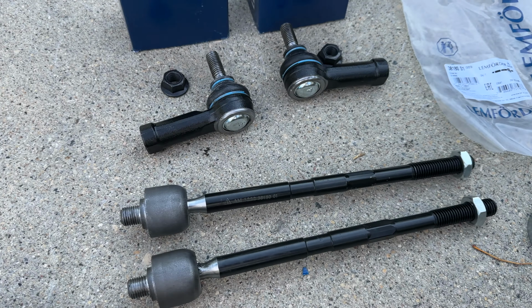31 foot pound and 15 foot pound for flare nut fittings. So I am using here 30 foot pound of torque. And the torque wrench just barely fits on the bolt.